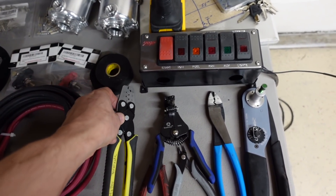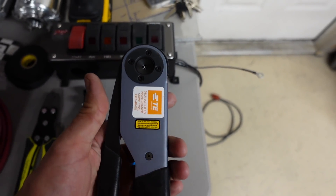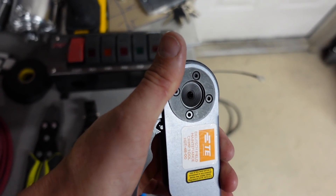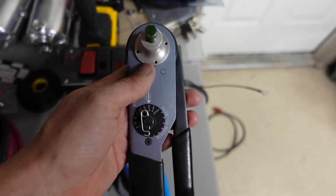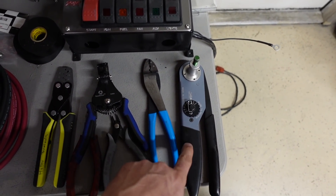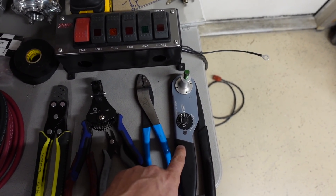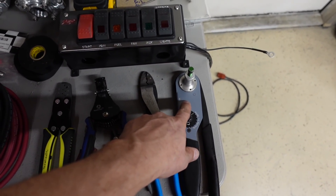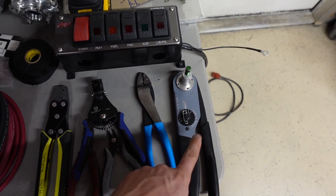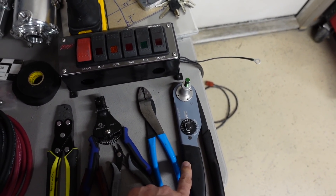You'll need a pair of those — they're about 20-something dollars. Last on the crimper list are the T&E crimpers. These are really expensive, but they handle all solid barrel contacts. You can adjust the depth and strength of the crimp. These would be for solid-pin Deutsch connectors, and also for a lot of bulkheads that go through the firewall. The Maven Performance bulkhead on my Mustang has 100-plus pins — T&E crimpers did all of those, fabulous job. Don't try the cheap alternatives; you will ruin your connector.